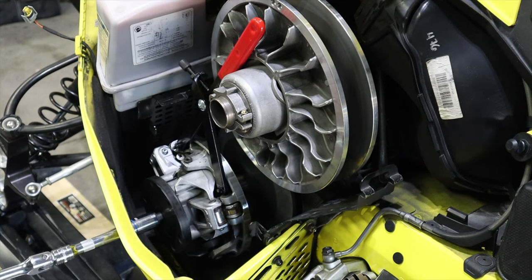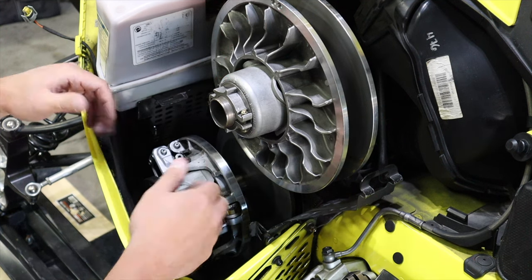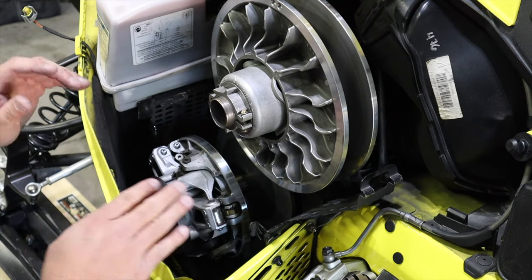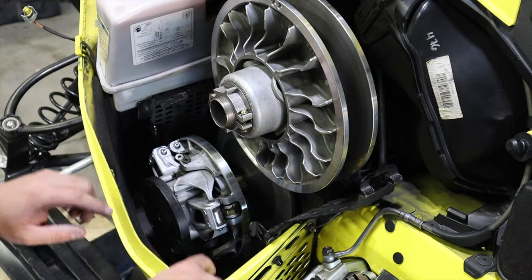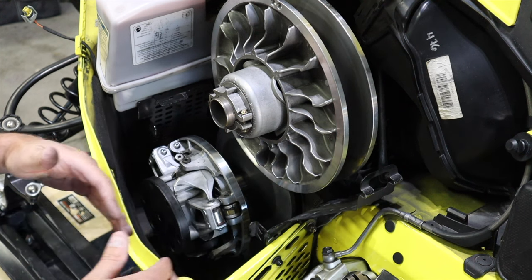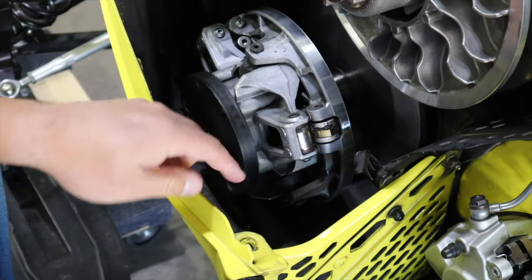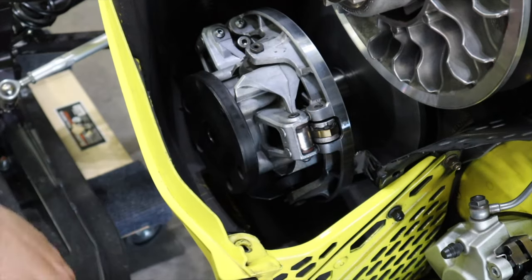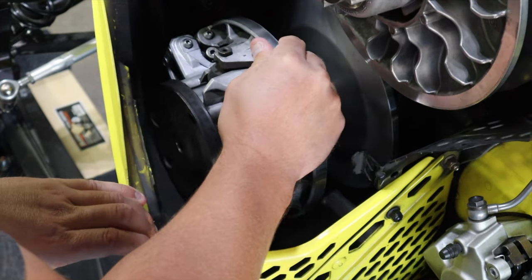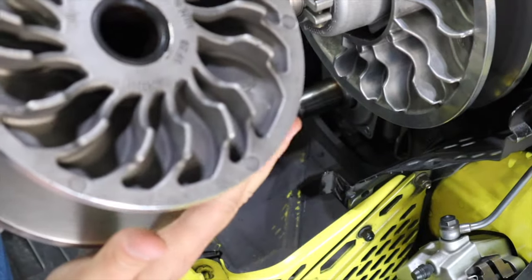Take your time, do it right. And once it's popped off, you can just take the bolt right back out. Now to remove this out of here, it's kind of a tight fit. You can't actually do it with this up here. So take a T25, pull this bolt out right here, and then that will allow you to pull this panel out to where you can actually remove the clutch and back this bolt out. And then you can see that gives us a ton of movement there to go ahead and lift our clutch out.